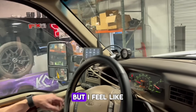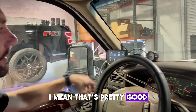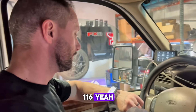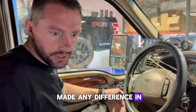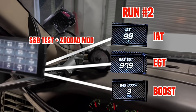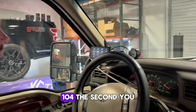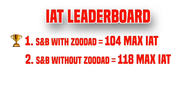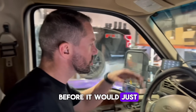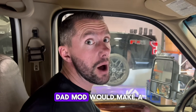I barely cracked 100 that time, but I feel like you need to do two dyno runs in a row because it really gets the engine hot. It's already dipping back down - that's pretty good. I think we were seeing like 116 before. So that did make a difference. Let's see if it made any difference in the horsepower. The main thing is the IATs cooled down, which will make a big difference when you're towing. During the run it was 102, maybe saw 104 for a second, and then it's already back down into the 90s. Before, it just sat there at 118 heat soaked. I think when towing up a big hill, the Zoodad mod would make a big difference. KC Turbos approved - at least the Zoodad mod with the S&B.